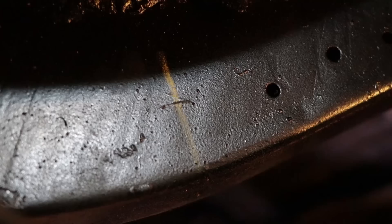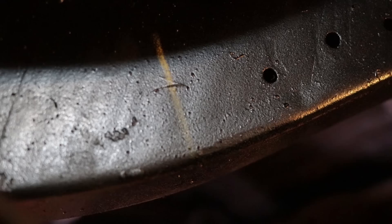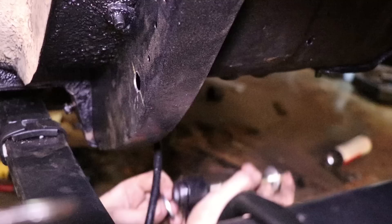On the inside of the frame rail, that's the mark where I'll be drilling my hole. I took calipers and measured a horizontal line running parallel with the frame rail — that's where I marked it, and made a little scratch so I could tell exactly where I want it. It turns out it's just a tiny bit over 1.25 inches — and it's going to be different for your vehicle, so make sure you measure the same way. Once I measured that out, I took a piece of card stock and ran it around the underside of the frame rail. When I pulled that card stock tight, I took a paint marker and marked it with a yellow line, then measured 1.25 inches from the bottom of the frame rail. Then I scratched the line where that caliper lined up and made a little arc — and where it crosses is where I'll drill my hole.